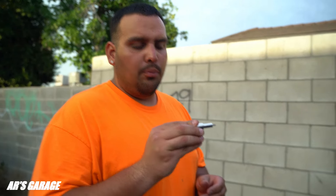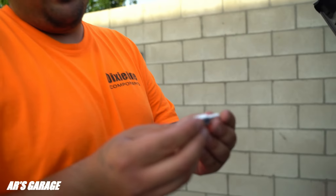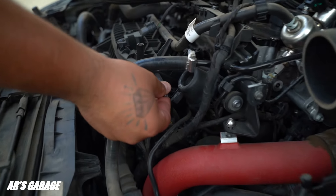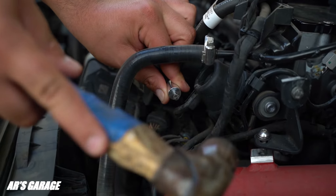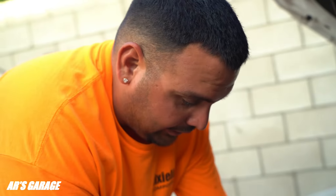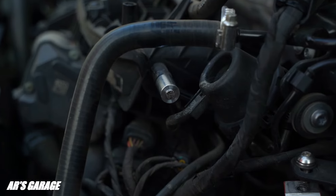The boost tab comes with this tool to puncture the intake manifold — it's basically a nail. You're going to need a hammer for this. We're going to go ahead and insert it right here in the little hole, grab a big hammer, and drive it in. The guy in the video said it doesn't take much force — apparently it does. There it is, it's punctured.